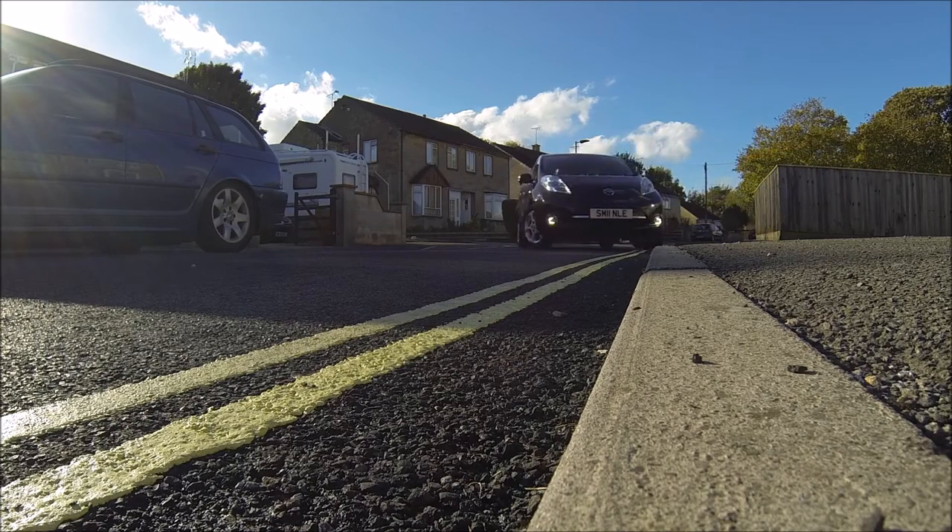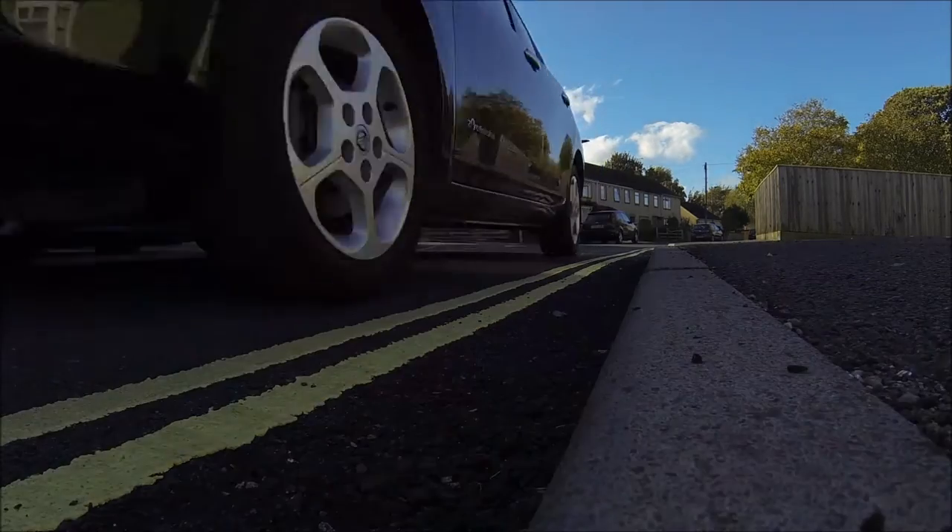126 calories — no way. Off to Bristol via Nissan to pick up this tripod. Running late as usual. The guess-o-meter is saying 79 kilometers, or just under 50 miles. However, Leaf Spy is telling me I have more like 35 miles — day in the life of the general Leaf driver. The other really useful thing about Leaf Spy is that it tells you, based on your current trip, what your energy efficiency is. At the moment it's unrealistically low because we've just been down several hills, but it will average out.